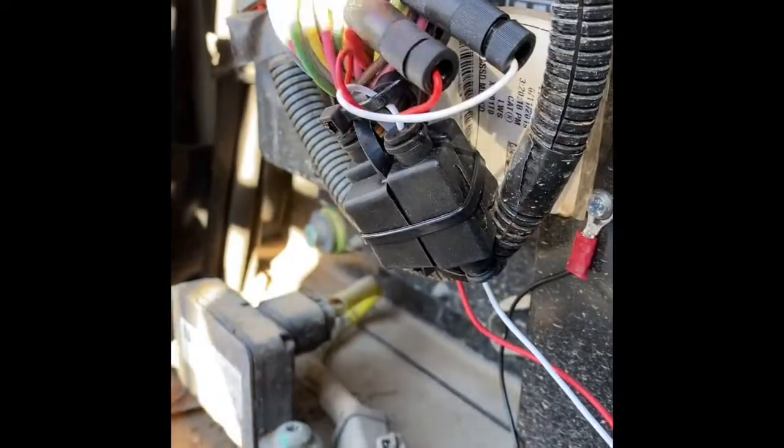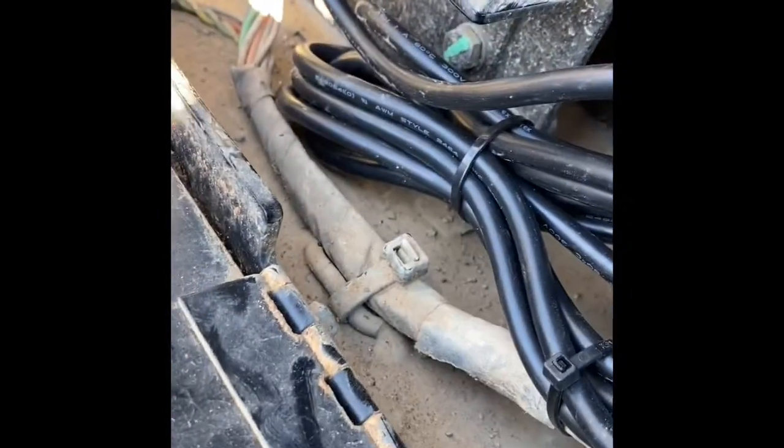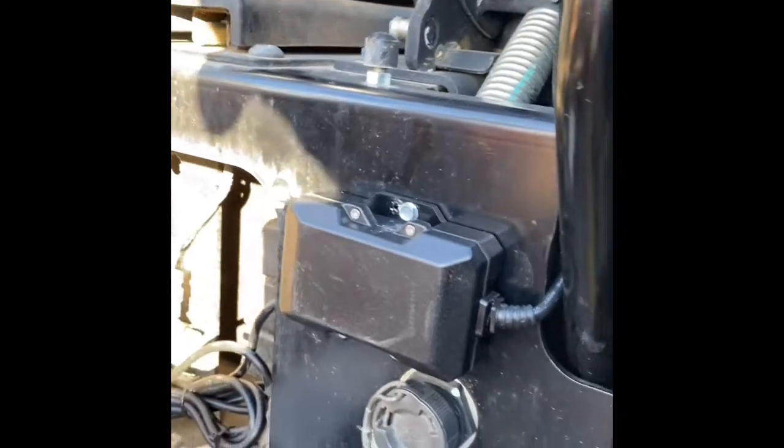That's okay — no problem at all. We've just tied everything together, our excess cable, and we've mounted our box at an angle, which is fine. This is an open cab, so it'll get good GPS signal. You can also see where our lights are flashing, and as you can see we've got a great GPS signal.